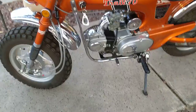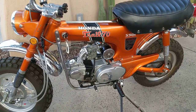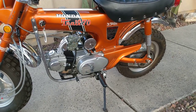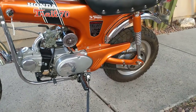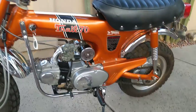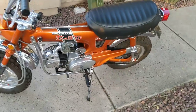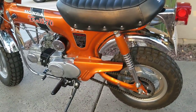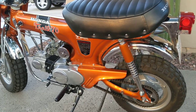I didn't meet them but the story I have is they bought the bike new and it was stored inside a warehouse there for many years, not running. When I got the bike it had about 2,000 miles on it. It was not running. I discovered it had a problem with spark. I fixed that and got it running but it didn't make very good power, so I knew something was going on with the engine.